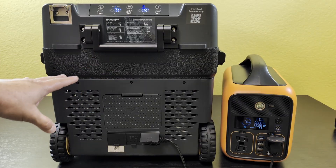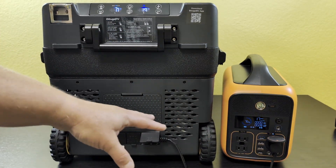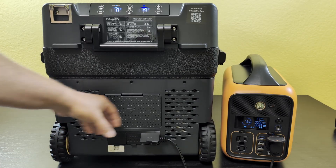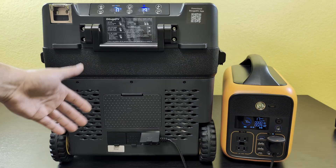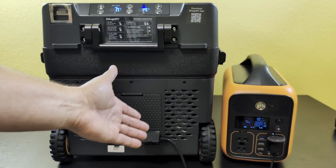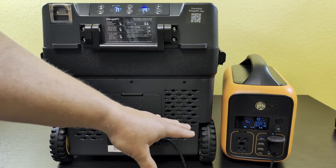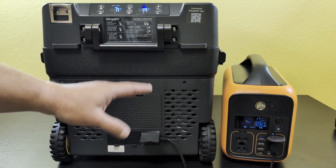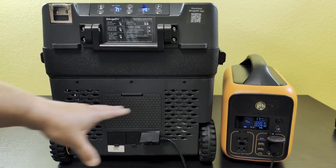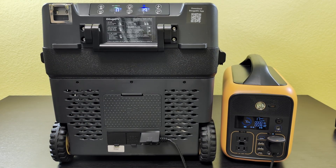I've let this run for quite a while and it is down to temperature. If you notice down here, it's using about 30 watts. That seems to be what it uses when it's down to temperature. Something's running in there more than just a fan, but it's not doing the 65 or the 45 watts like before, and it's not even in eco mode. Once it cools down you're getting around 30 watts, and then sometimes it kicks on and goes up into the 40s — maybe 40 to 42 — then drops back down to 30. I think that's the wattage range it's going to be playing in.